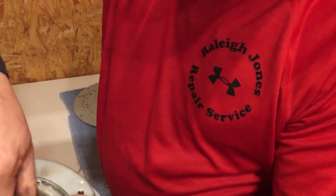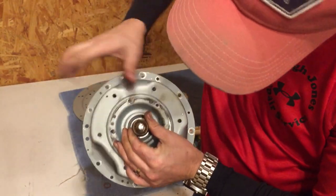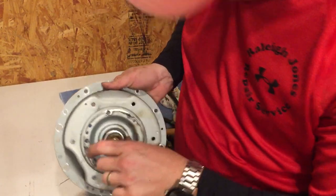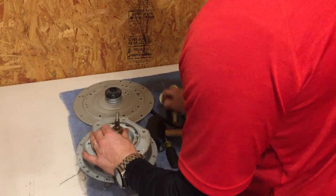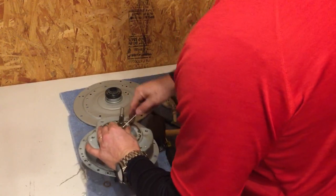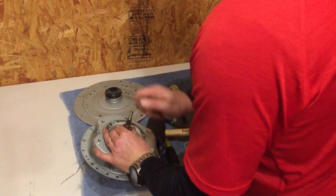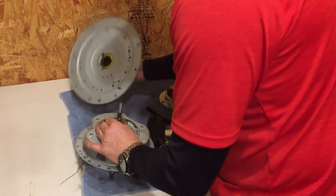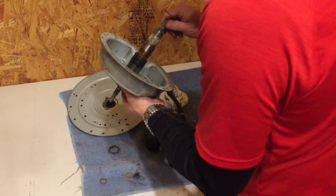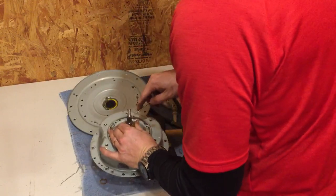You're supposed to get some kind of action but look at the bearings right there — they're all screwed up. That's what we were hearing. Let's see if we can pull all the bearings out of it. The failure was not in the actual bearing the shaft rode on, but the shaft has a gearing system and the failure was inside the shaft where the gearing system is.